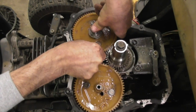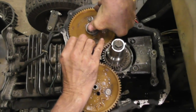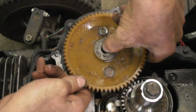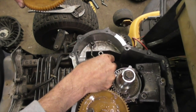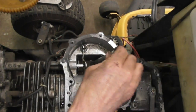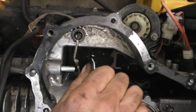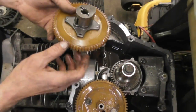So if you want, you can push hold down on this because that little rod will come out. And you can take this cam out. Got to be careful though. Here we go. Because there's a little pin in there and this whole thing will come out. See? And it's got a pin on the bottom. And it'll lock into a spot down there. There's your compression release.